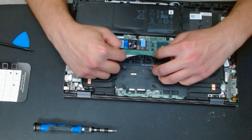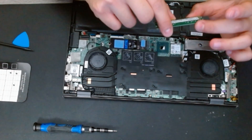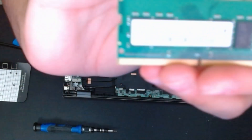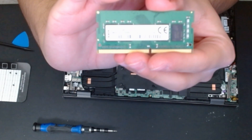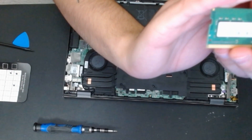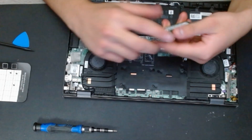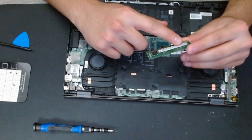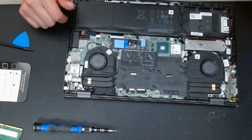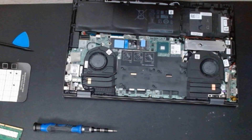Pull the arms to the sides and the RAM came off — that's easy. This is a Kingston 8 gigabytes RAM stick. It's Kingston 8 gigabytes at 2400 MHz. Like I said, the slot supports 3200 MHz, so that mismatch is not going to affect performance dramatically, but why wouldn't you want to use all the performance available in the memory?